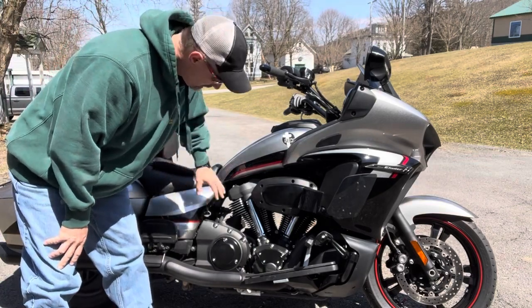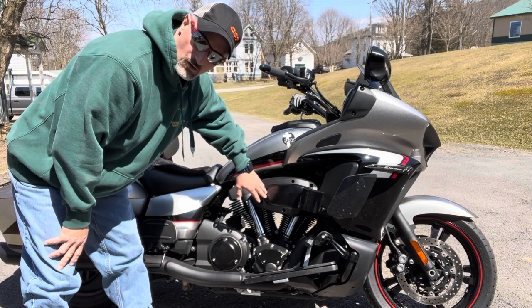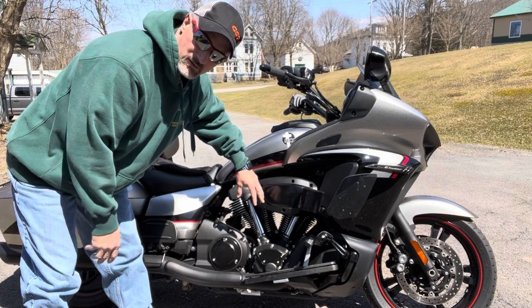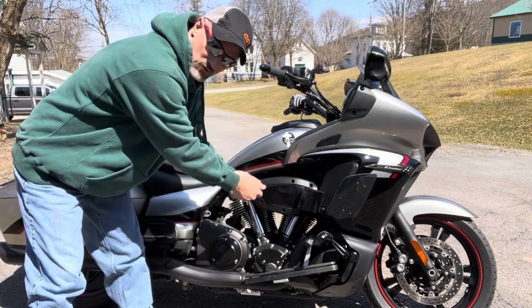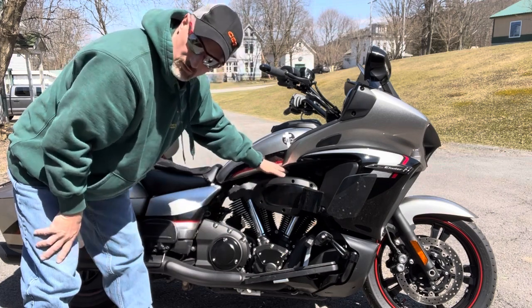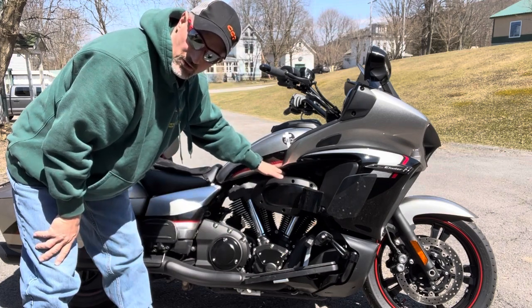The side panel and seat all came off. Right about in here, where you get to the throttle body, there's a plug on the back side of that — that plug had to be unplugged. Then the Power Commander just plugs in-line on both sides of that. You route the wiring over — there's one for the front injector and one for the rear injector.